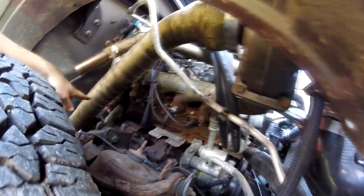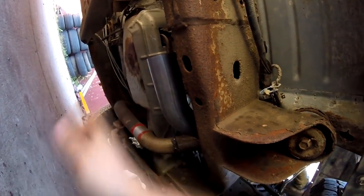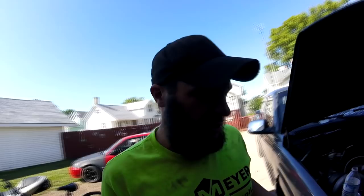I got all the wires on. And while we're down here, I got the 3-inch exhaust down to the bottom of the truck — right down to here, and this is where it's coming out so far. I also bought two 10-foot sticks of 3-inch pipe and a Thrush turbo muffler — it's like a Cherry Bomb but it's an actual muffler, not just a glass pack. 3-inch in and out on that. I plan on running a full 3-inch exhaust with a muffler all the way out the back.